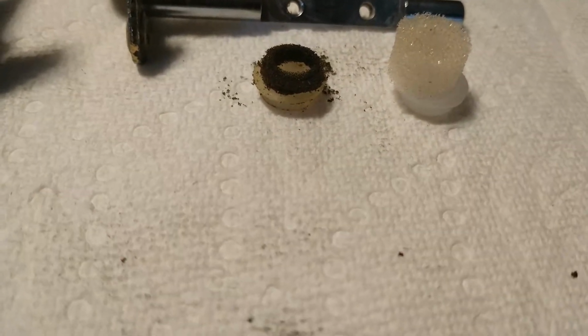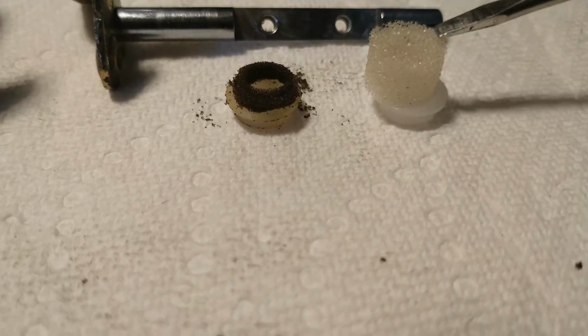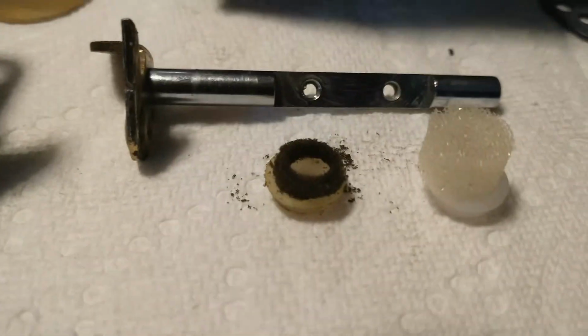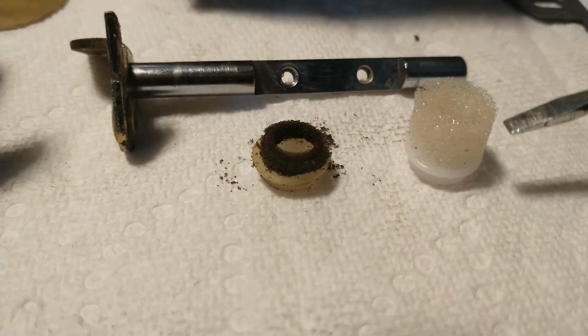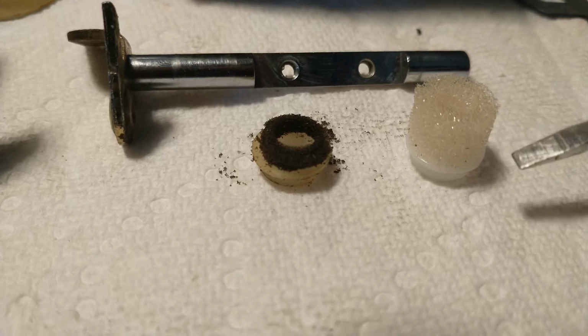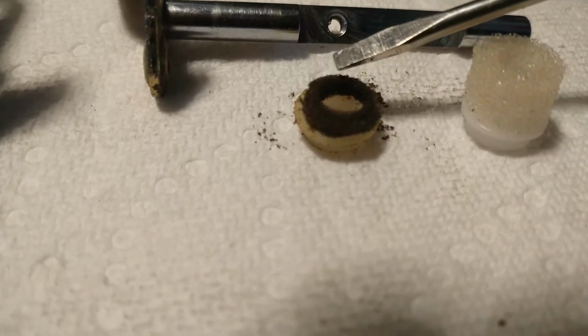on carburetors like this is this foam gasket. There's the original, and there's the new one. You see this goes around that throttle shaft there, and that goes into that bore. Now a lot of carburetors have these. You can see them on the push mowers. Briggs Quantum engines have those. You see them on Tecumseh snowblower engines, and they're often overlooked when they go bad or go missing when they rot, like this one did. This one's going to powder.